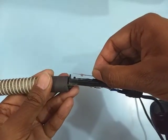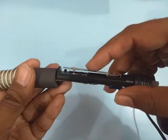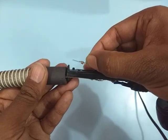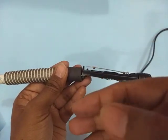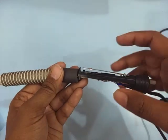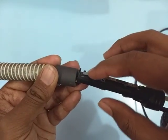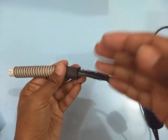The strip bends upward as temperature rises because it is a bi-metallic strip — the top metal and bottom metal are different, so when heated it bends upward like so, breaking the connection and stopping current flow — that is the off position. Eventually the water and strip cool down enough, the strip returns to its original downward position, makes contact with the bottom terminal again, current flows, and the heater turns back on. This cycle keeps repeating and that is how the heater works.